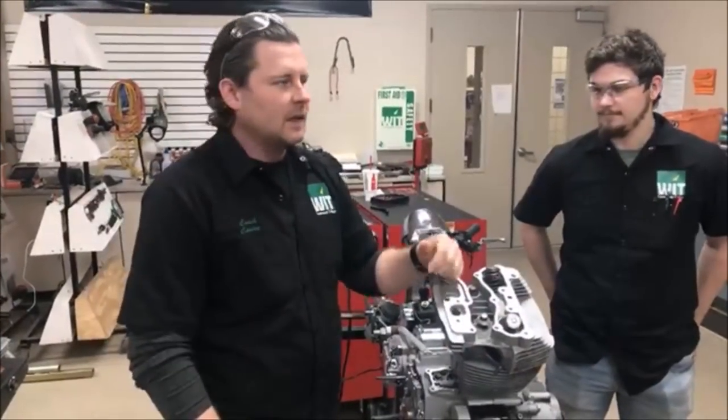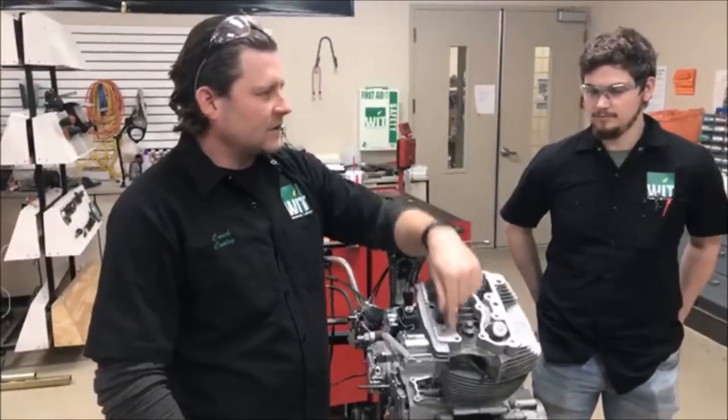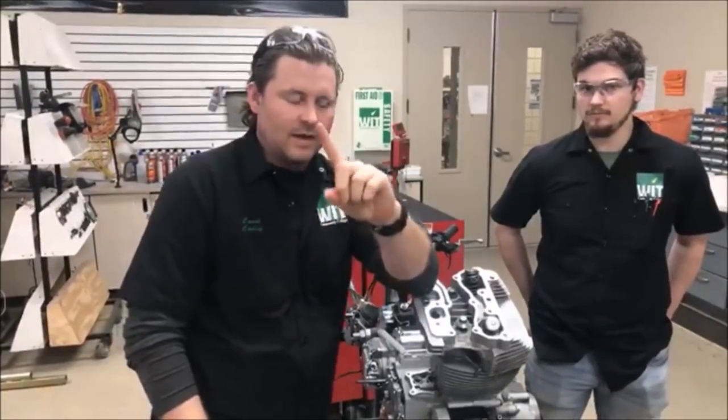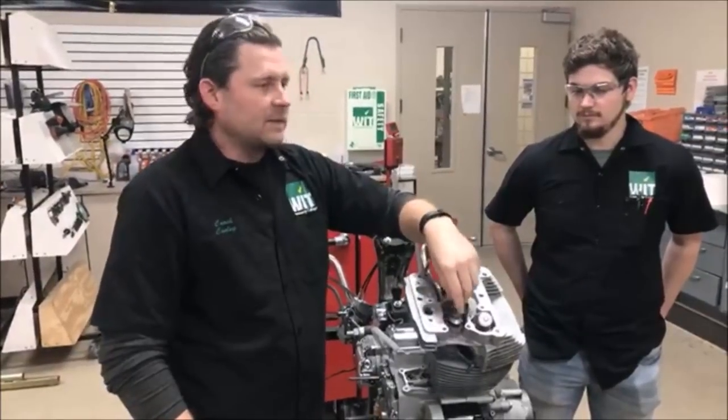And you're gonna think you're done, but if you don't have the oil on there, you have a false torque because it's dry, it's dragging across there. So that acts as a bearing surface. So that's tip number one. You have to know when you're supposed to oil those if it's part of the torque spec.